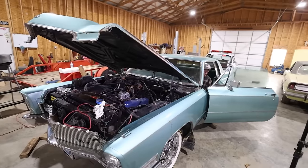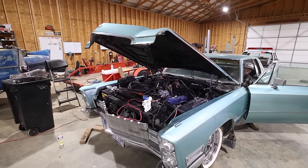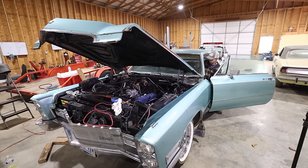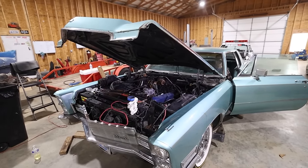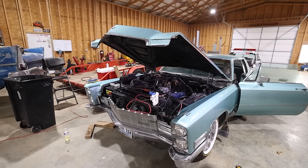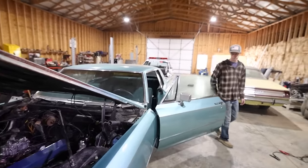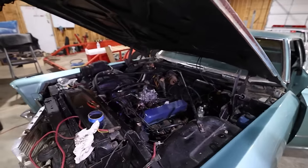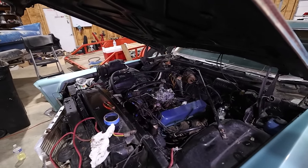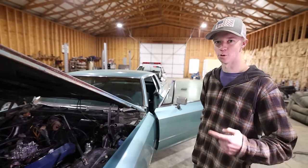Okay, well good, go ahead and cut it off before it gets too hot. That's much better. See how it cranks hot now. That's good. That's really good. Much, much better. Awesome. Well, that fixed that. Being able to adjust the timing can do a whole lot of helping there, don't it? Ain't that crazy, just to be able to adjust the timing, we had to break the distributor in two pieces. But, yeah.